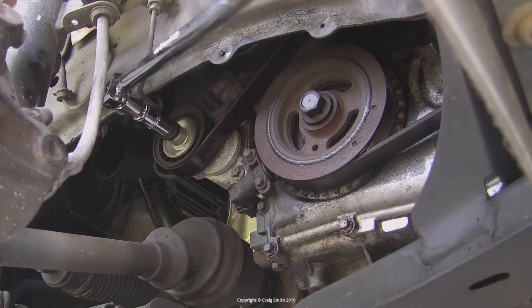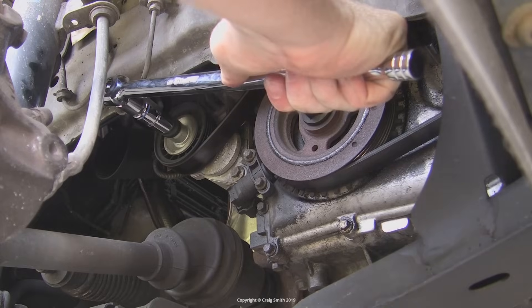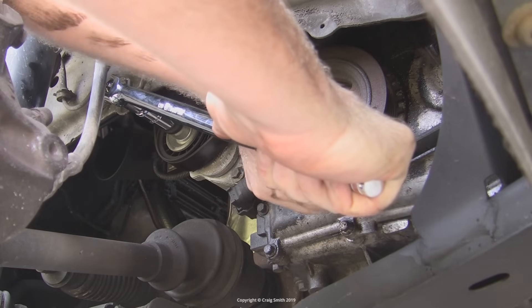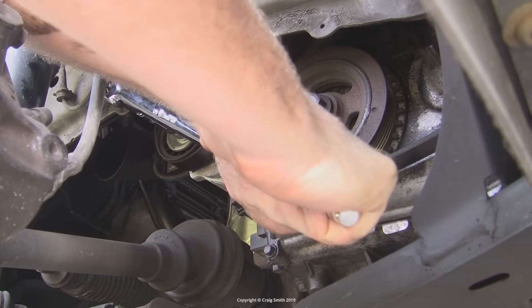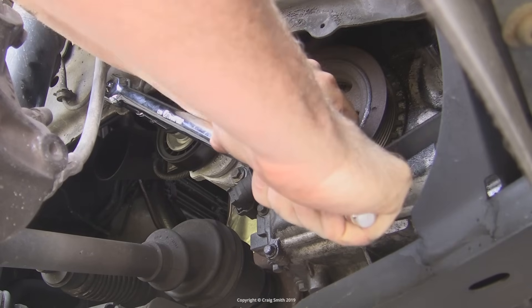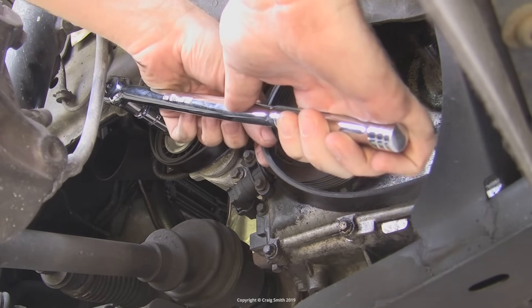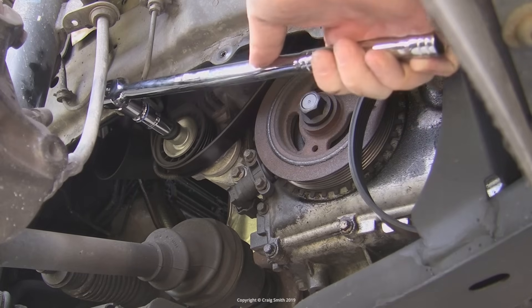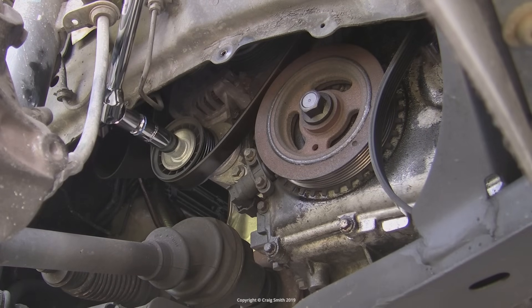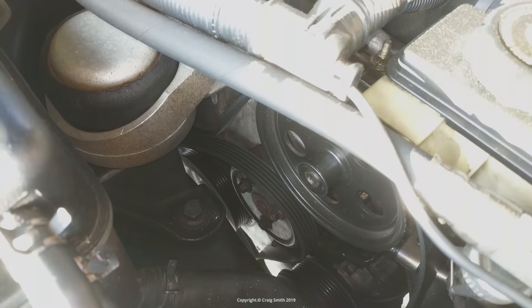It can be really hard to pinpoint engine noise, and the easiest way to rule out the accessory drive system as a whole is to just disconnect the belt entirely and then run the engine. Now that might seem dangerous, but it's really fine. You just need to be aware of two things: one, you don't have any cooling because the water pump's not running, so the engine will overheat if you run for long enough. And two, you don't have any electrics other than as supplied by the battery, which won't last long without the alternator. So I've disconnected the belt from the crankshaft pulley here, and you could take the belt out completely or just make sure it's held well clear of the crankshaft.